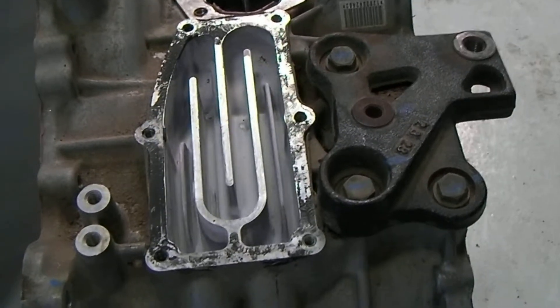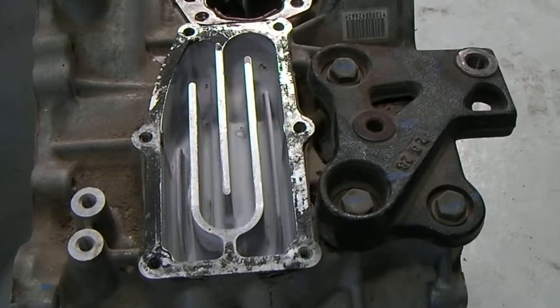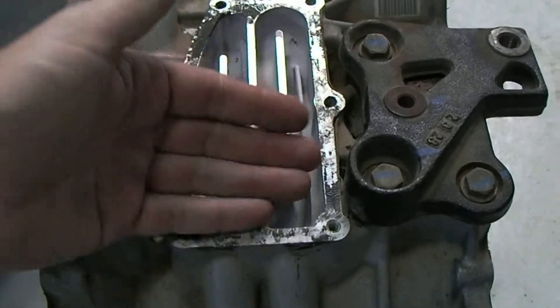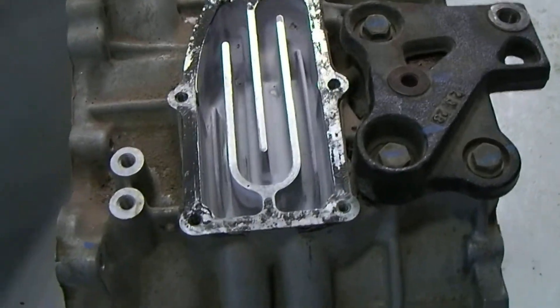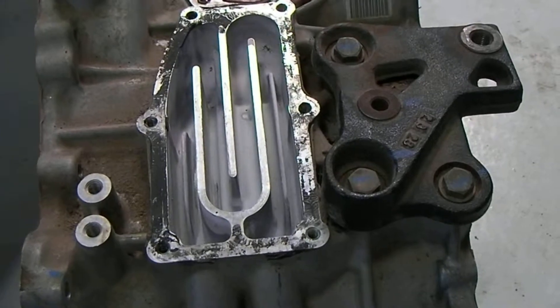This is for cooling MG2. MG2 can get hot under heavy loads and or rapid acceleration. And having this heat sink up here on top, any heat that is going to naturally rise within the transmission can be drawn out by the coolant here.